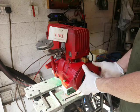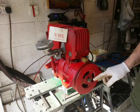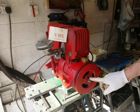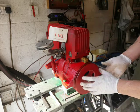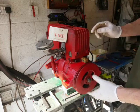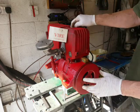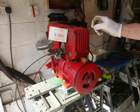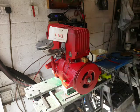I've verified this mark. The reason I've done this is because sometimes the key which connects the crankshaft to the flywheel can have a little bit of play, so I like to make sure I know exactly where top dead centre of the piston is and not just rely on the flywheel — it may have moved a few degrees. Having said that, it's not that sensitive. So now I'm going to set the points.